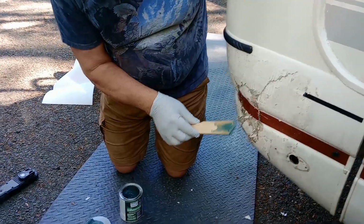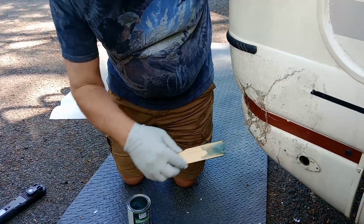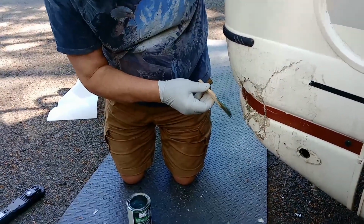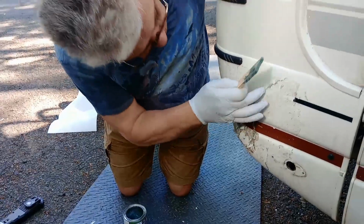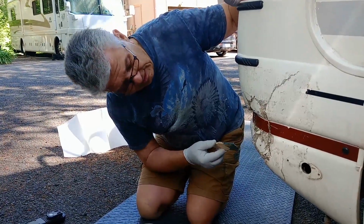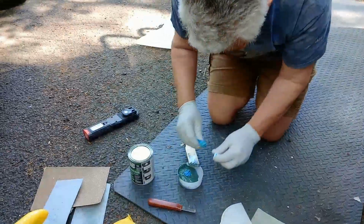So here Jorg is looking for the best place to put the fiberglass reinforcing paste. He needs to know that before he mixes it, because once he adds that hardener, he's literally got about 5 to 10 minutes to actually put it on there and smooth it into the shape he wants before it is impossible to move. So what are you mixing there, Jorg?